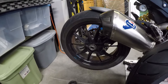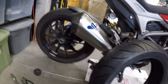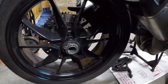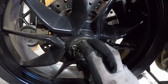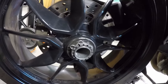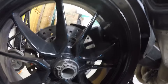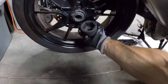But that's not the point of the video. The point is to show you how easy it is to get a rear wheel off a Ducati if you've got a stand — either a rear stand or a center stand — that accommodates a single swingarm. As I mentioned when I took the sprocket off the other side, I usually just safety wire this just because it makes me feel better knowing it's not ever going to fall off. Here, I'll show you — we'll go ahead and pull this off. This nut is a 46 millimeter; it's pretty hefty.